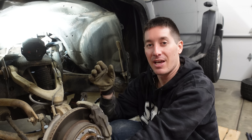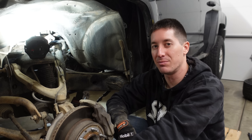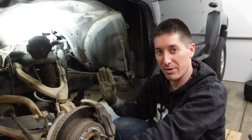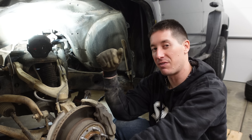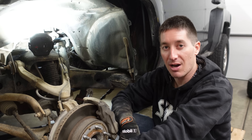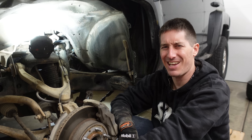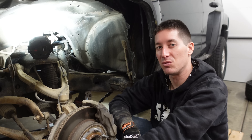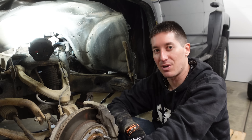Somebody jumped in here and changed the transmission and replaced the factory torque converter bolts with the wrong bolt — it's a 15-millimeter now and it's supposed to be a T50. You can normally get your T50 through the inspection slot on the bottom and just pull the bolts out no problem. Well, even with a 15-millimeter crow's-foot wrench we're having no luck, and our double-offset pops off every single time. No matter what we try we can't get the converter bolts out because they're also insanely tight. So we decided to try pulling the starter out so we can get an impact in there and pull the bolts out that way.